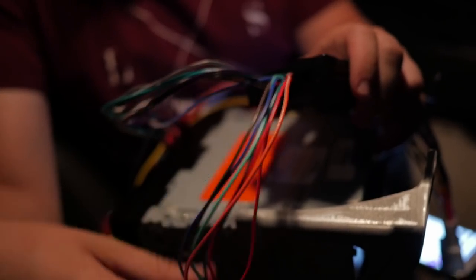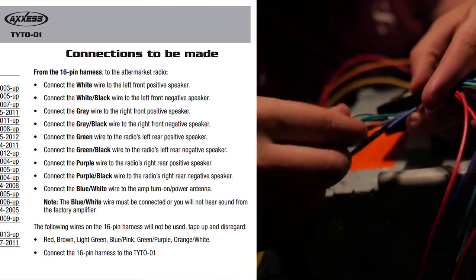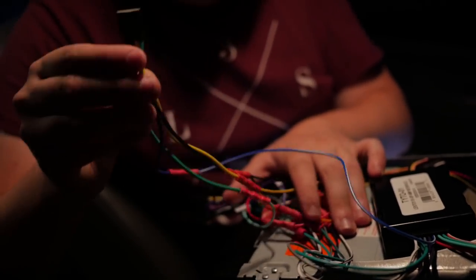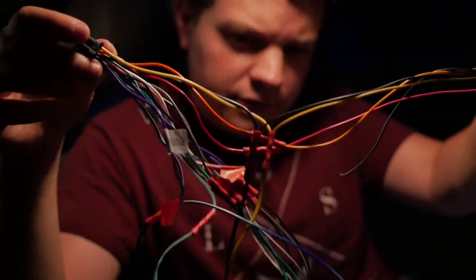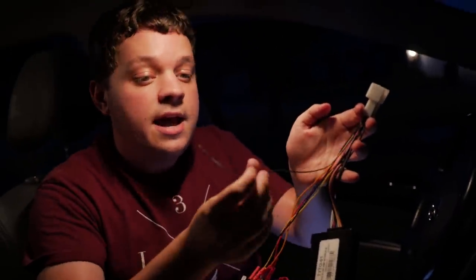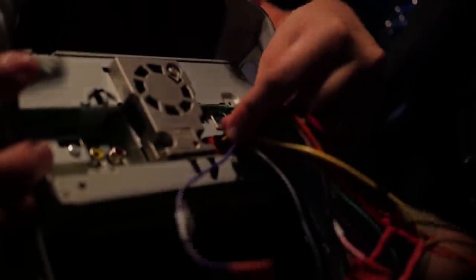This is one wire set that comes out, and about half of these wires aren't used, so those cables can be taped off. The blue and white, purples, grays, oranges, and whites will connect to the wire harness that connects to the stereo. I went ahead and connected the parking brake bypass the exact same way. There are also wires coming off the other end of the adapter — just mark off which wires you don't need and it's basically matching them. The instructions didn't mention the black and white wire, so I'm going to ignore that. Now the second harness plugged into the original stereo is for steering wheel control — we'll deal with that in a minute. Then I'll connect the antenna into my Pioneer radio, which plugs in right there.